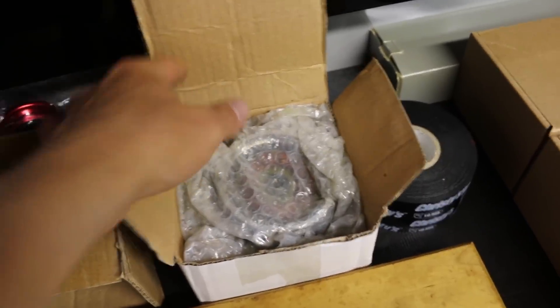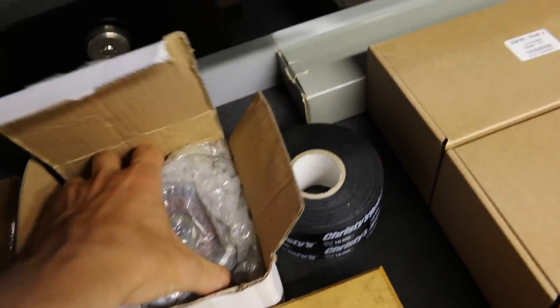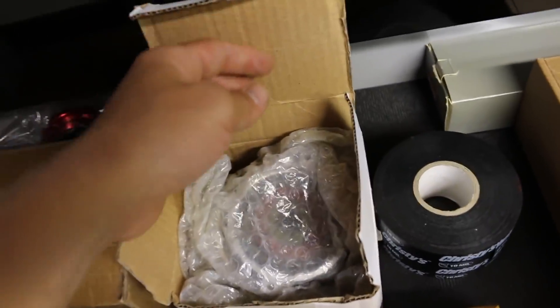They ended up sending a couple more bearings, but I'm not sure which one I need yet. The full circle crank might need a different bearing entirely because the opening is a lot bigger. I tried those bearings and they're still completely loose, so I think this opening is really bigger. I asked the crank guy — this is a 44mm, which matches the big bore kit — but I'm waiting until Monday to get a straight answer. For the electric start that everyone's been asking about: I got a straight answer that we need 12 volts, and the one wire off it is for positive, grounding out through the engine and frame.